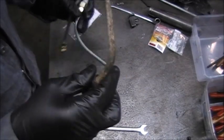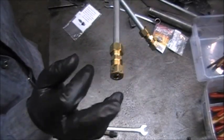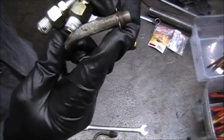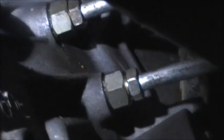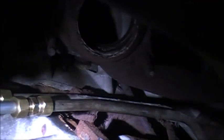Here are the lines set up. This is the old line right here. These are the new lines that are cut and set to be connected to the old line. And this compression fitting is way stronger than this clip holding at three different points on this flange. I'm going to screw this to the transmission and connect these two to the existing lines. These are the lines screwed into the transmission — the 4L60E — while it's on the vehicle. I don't know if you can see the compression fittings, but right there — see how they're tied in to the existing lines, right there.